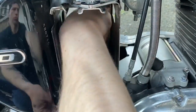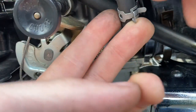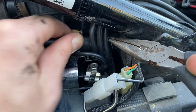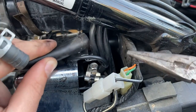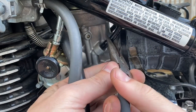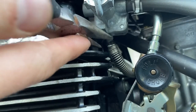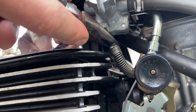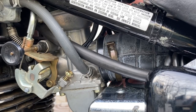These four bolts take a long time to get out because there's not much room in there, but you'll get it. Next you want to start by removing all the hoses connected to the carburetor. These little rubber hoses just go to nothing underneath the gas tank — they just go to open air. So watch out because those will probably just fall on the floor when you take them off.